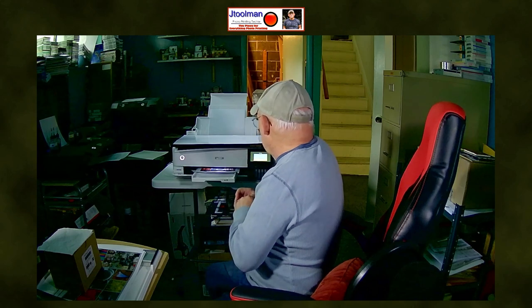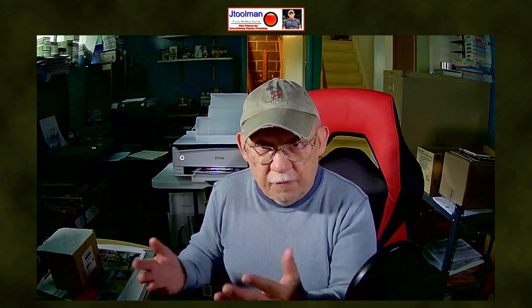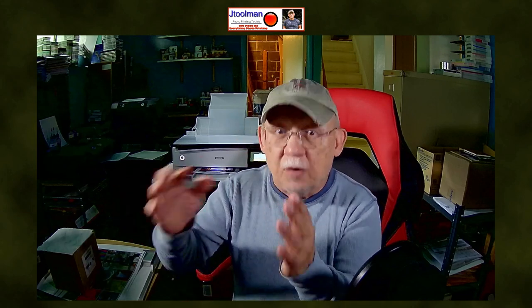Here we go, getting the results now. This is the one I did a day or so ago — we'll compare it to today's print, and they should be basically identical. The next one coming out should be the black and white version using black and white mode in the driver. One thing to remember: black and white mode is different than printing a color image that has been turned to black and white using a profile. In that case you're actually printing full RGB mode and you need a good profile, otherwise you may not get a neutral final print.